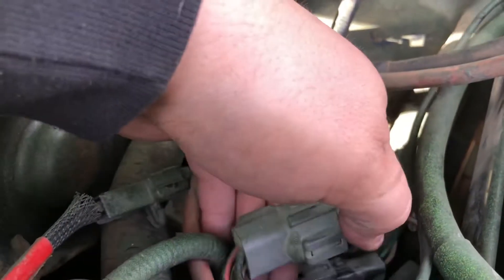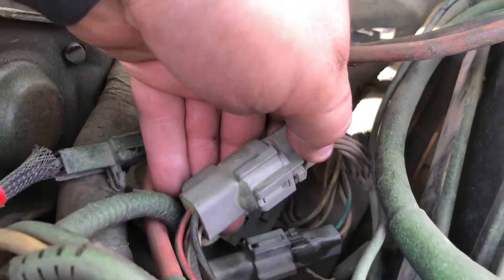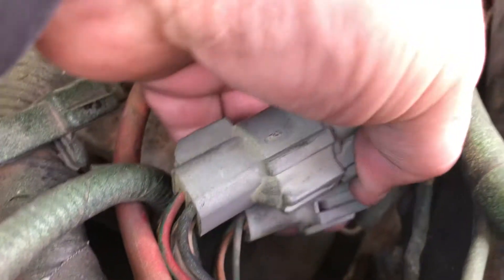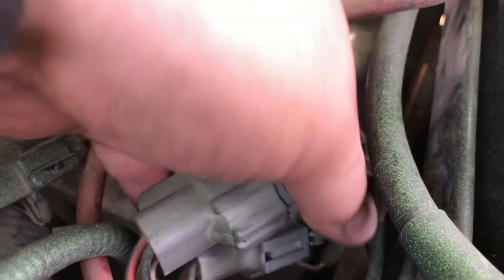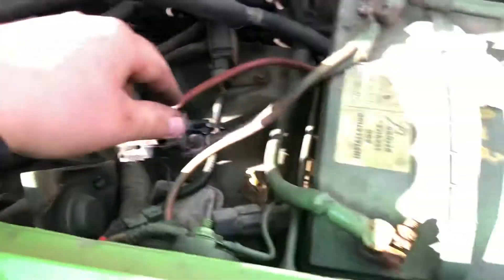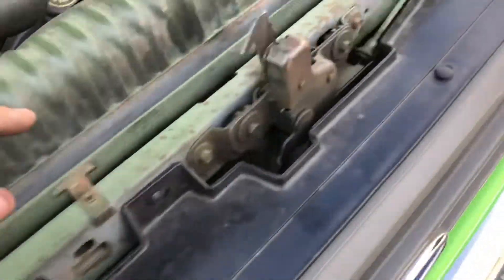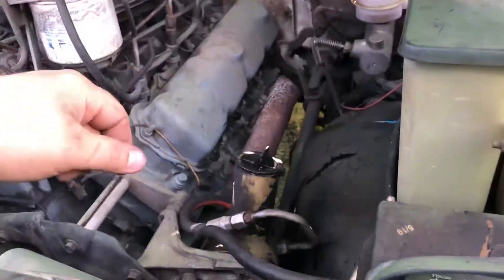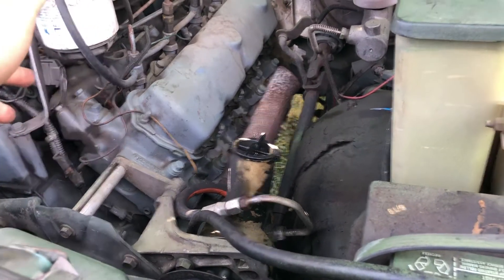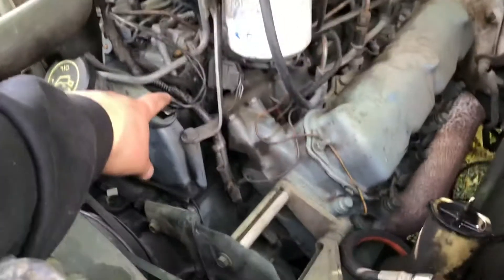You can check for corrosion — these trucks are obviously old. You got your connection here for the TPS wires, and the smaller one down at the bottom is for the tach. You can ohm from there to there, and that wraps all the way around the front where you can find your other wires and try ohming it there.